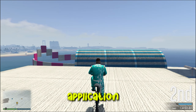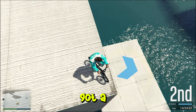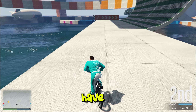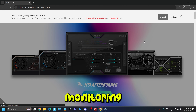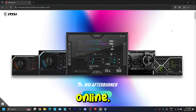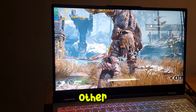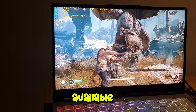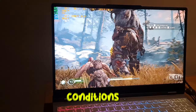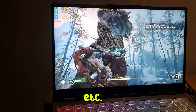Now for the final test — the real-life application of the laptop: the game test. Assuming you own at least one AAA title, before running it make sure you have an FPS and temperature monitoring software like MSI Afterburner, which is free and easily available online. After installing it, run the game and check if the FPS, temperatures, and hardware usage match the benchmarks available online for the same game. A variation of 5-10% is ignorable, as test conditions like room temperature, background tasks, and internet speed may vary.